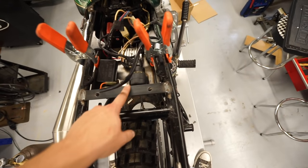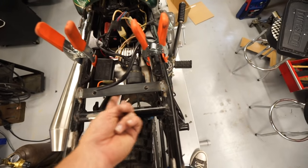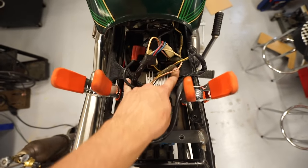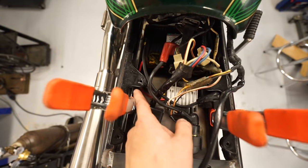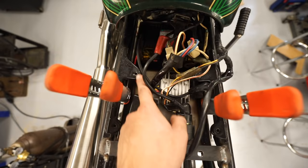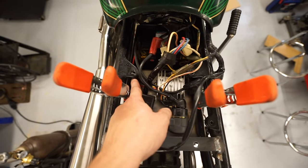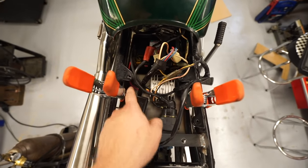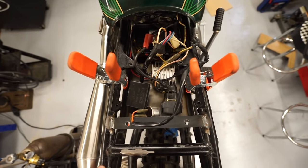So I'll probably do a little 90 degree piece of angle iron either underneath this and weld it to the back of the box or on top, and then utilize these front two ears that are kind of hanging off here. So basically I'll get a piece of metal and have it come out of the side of the box, and then we will drill these, they're threaded right now, we'll drill those through and we'll either thread the piece underneath or weld a bolt or something on the underside so that we can bolt directly through it. And that'll give us our four mounting points, and it should be more than sturdy.